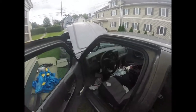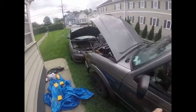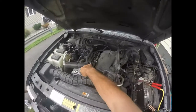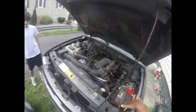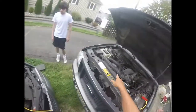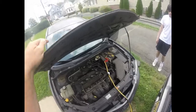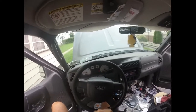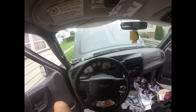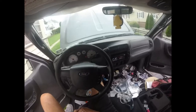The car with the good battery has to be started up. Now while this car is running, this component right here called the alternator — it's like a generator — is going to generate electricity, which will flow through the cables and charge that dead battery up. Sometimes it takes two or three minutes. I'm going to raise the RPMs to about 2000 and hold it there, which will make the alternator put out more electricity so more electrons flow through to charge the battery even faster.